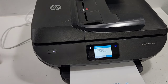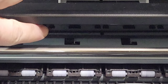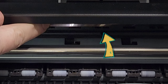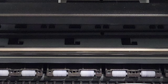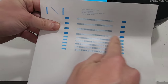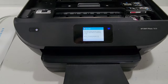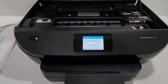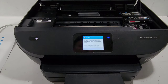The second thing we can check is this timing strip right here — it's a strip in the back of the carrier unit, like a clear film right under there. If that's dirty it would mess up your alignment and on regular prints you're going to see breaks in the line. If you had a vertical line, you would see breaks in it with a dirty timing strip. That's cleanable — just use either warm water or some cleaner on a paper towel.